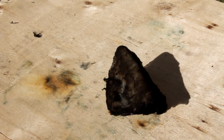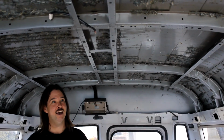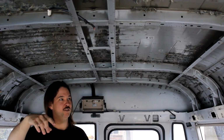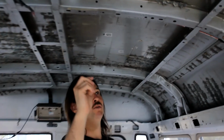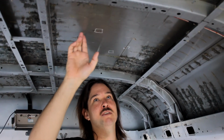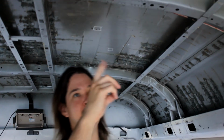Yeah, it's highly flammable. Ella's gone through and ripped out most of the insulation. She's got as much off as she could. This is sort of the best she's been able to get. A few little rust spots she's found along the way. So in those areas we've just come to it with the razor blade and scraped it back because we're not worried about it getting scratched now, because I'm going to hit it with a wire wheel and then put some rust conversion onto it and then prime it and paint it. We've found it over 3 different panels, so we'll do it on those 3 panels. And that will be the roof done, ready for the foil board.